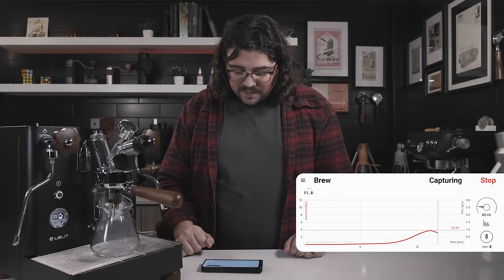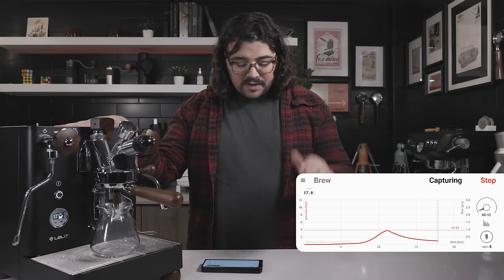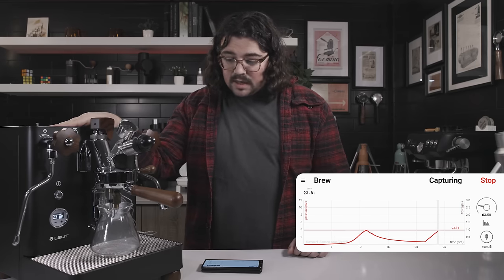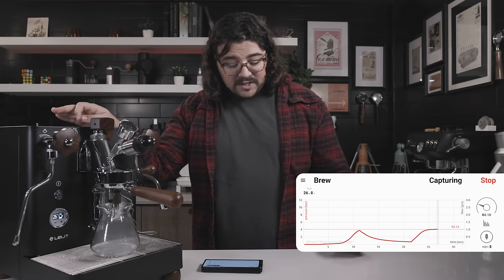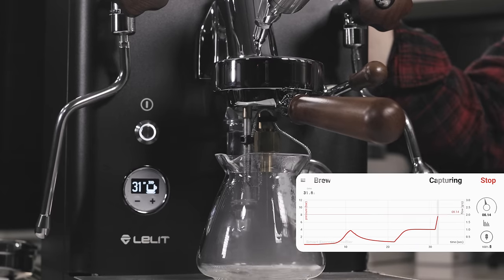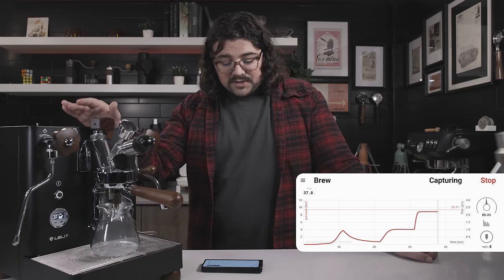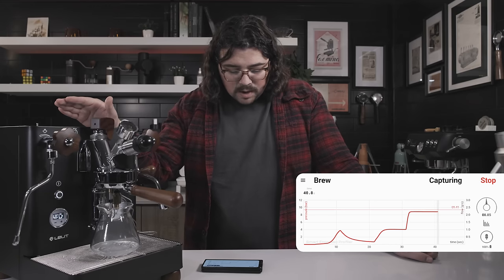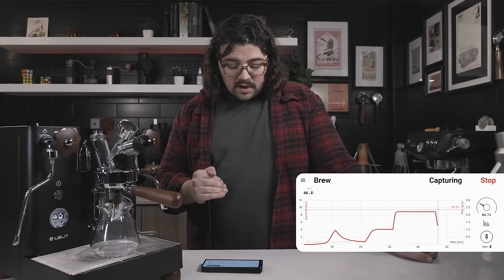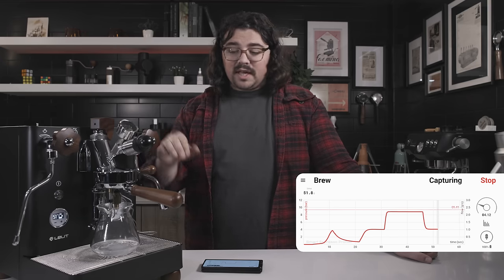I've started it — we're filling the group head with water. As you see the pressure is rising. That is pre-infusion; it only got up to 4 bar. Now the pump is off as the pressure dissipates through the puck. It kicks back on — doesn't get down to zero — and now it's going to low flow, which I have programmed next. As you see, it's only at 4 bar again. Now it shoots up to full flow and we're up at 9 bar. High flow is going, and then I have low flow programmed at 45 seconds — and there we go, back down at 45 seconds. Now it'll just chill until I turn it off.